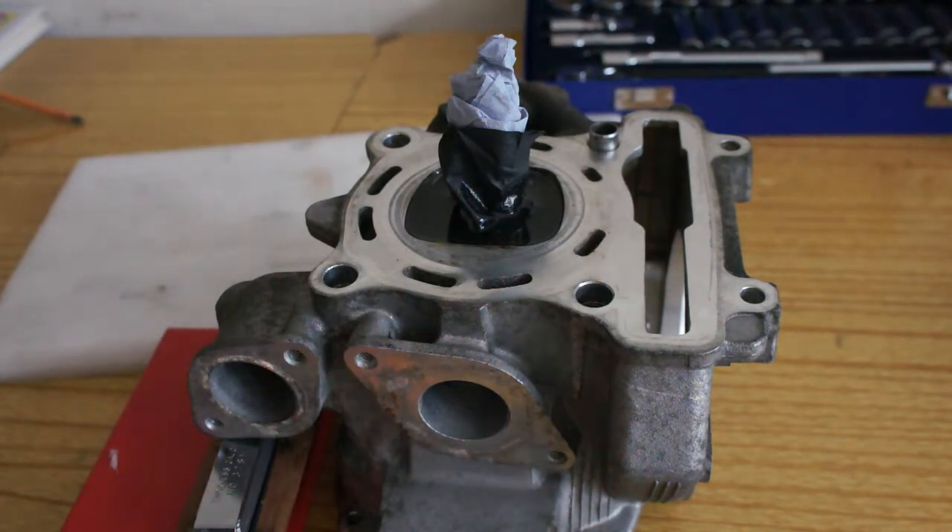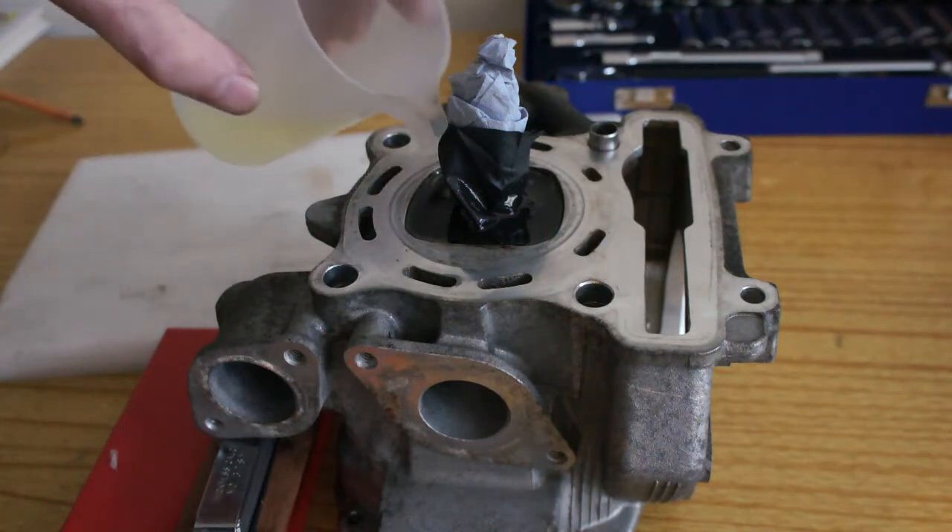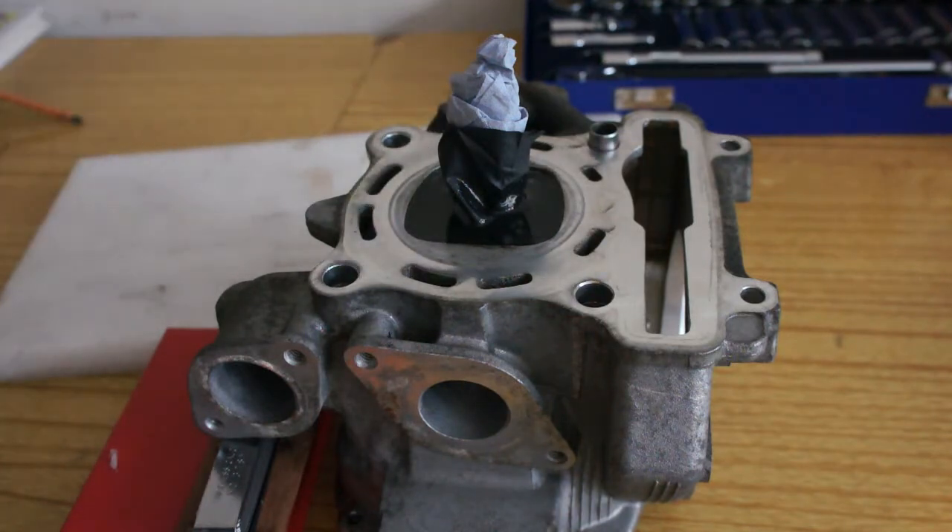There's no drop in petrol and there's no leak. If it is leaking, you're losing power, so it's worth regrinding your valves. I'll just leave that for 20 minutes and then come back and see how good it is.